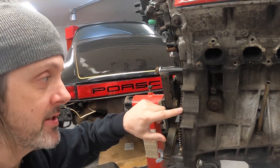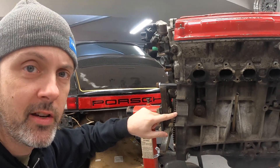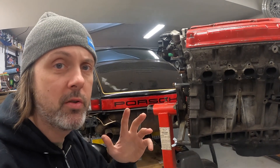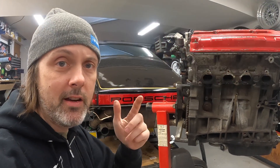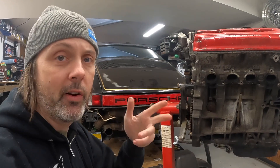The first thing I did was check the stamping on the block itself. It says B16A2 and has a serial number right here, which doesn't really decode to anything on the internet. The B16A2 was used in two cars here in the states: it was used in a 96 to 97 Honda Del Sol and the legendary 99 to 2000 Civic Si. I don't know which this is from yet.